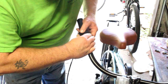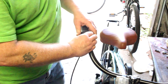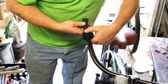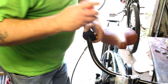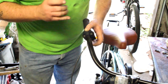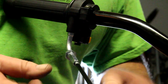You want to find the hole in the handlebar — it's a little tricky, but if you press down and hold things together you'll find it. Remember that cam piece: you don't want it down inside the housing, you want it above it, because if you start tightening things up with the cam down inside, you can damage the throttle grip. Hold it together, twist the throttle, and get a feel for it. Once you've assured yourself the throttle is twisting properly and not in a bind, go ahead and put your screws in. This is a plastic housing, so just get the screws to where they bottom out — don't overtighten. Get everything snug and secure with smooth operation of the twist.